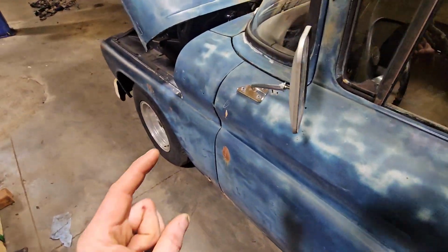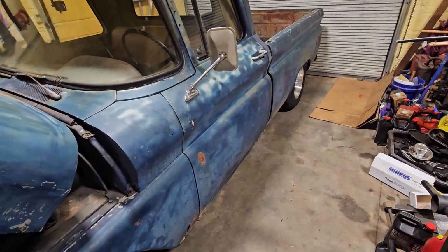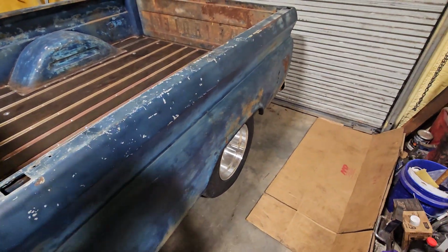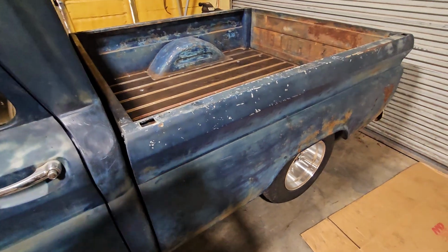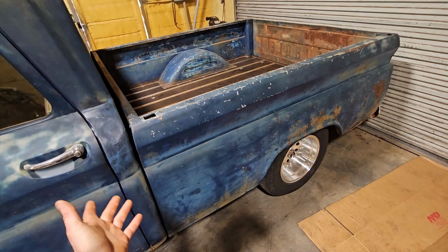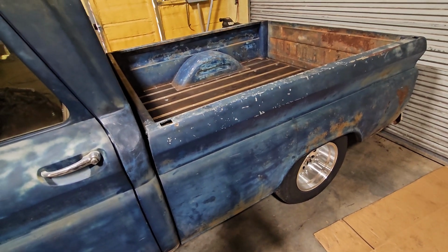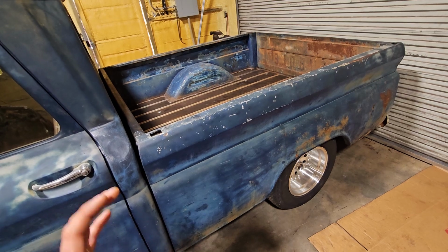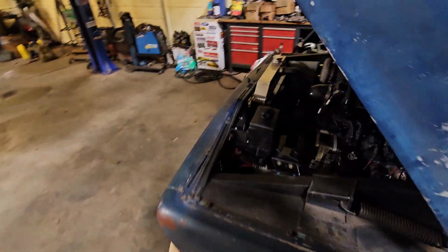So one thing too, is I had these springs left over from years gone by. The springs on the coilovers, so they were a 12-inch 250-pound rate spring, and I looked at a calculator online, and it actually came up to about a 250-pound spring. Typically on a Fox body Mustang or a race car or something like that, you want like around a 100-pound spring or a 120-pound spring, somewhere in there. You want a lighter spring, a taller spring, so you have the more stored energy, so when you launch you get the separation and plant the tire really good.